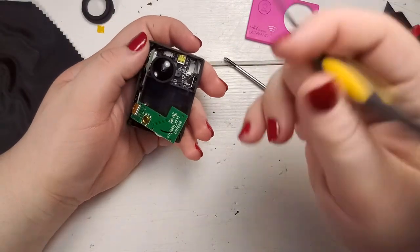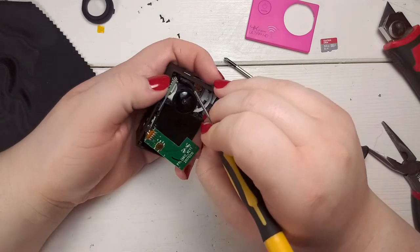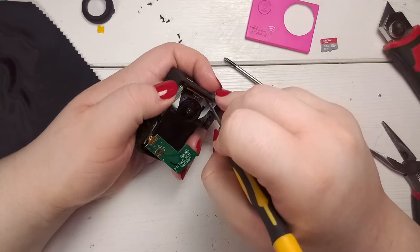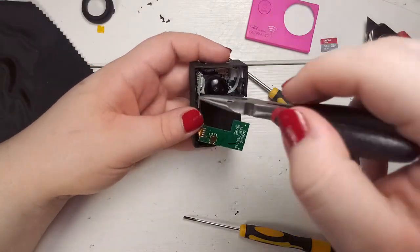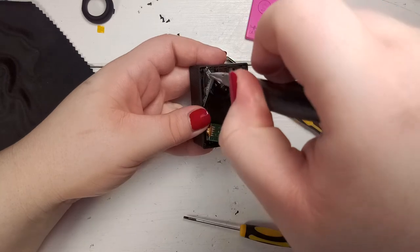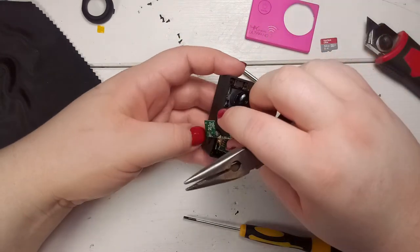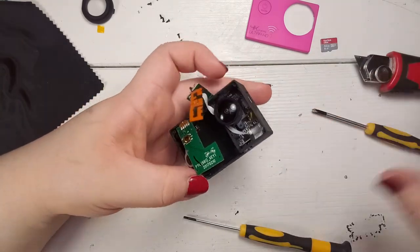Turn the camera back around and gently remove the sticker that is stuck to the side wall near the lens — this is the antenna used for Wi-Fi or Bluetooth connection. Use a pair of pliers to remove the PCB the antenna is connected to, and be careful with this long wide flat cable. These are not as fragile as the other ones, but still fragile.